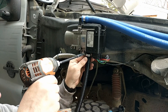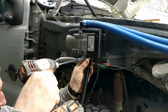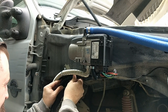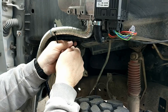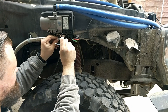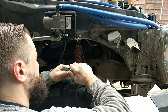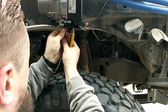I used the clamp as an anchor point for the zip straps that hold the intake air tube out of the way. It doesn't need to go anywhere special — just out of the slipstream of the vehicle into a clean-ish air supply area. The diesel fuel line is very thin tubing with a very thin ID and it just uses a rubber clamp.